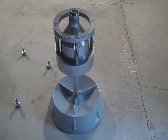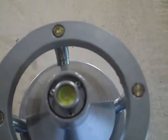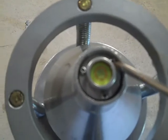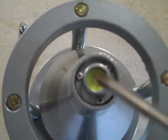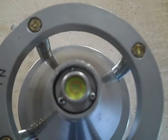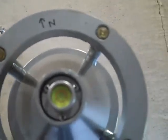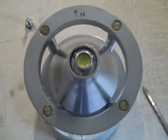Let's go ahead and do one of my wheels to show how I use this bubble balancer. I didn't bore you with the setup — it's very straightforward. The main thing is to find a nice stable level place on your floor. There are three screws to adjust to get the bubble right in the center of the red circle.